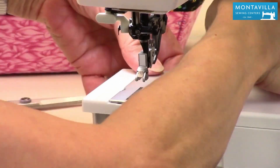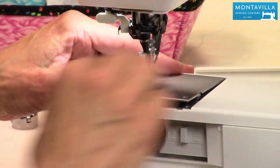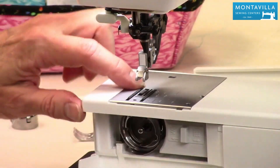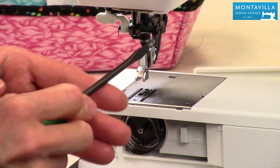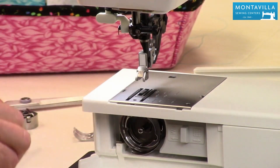I don't think I got it all the way on — I'm going to put that back on. I think you've got to start from the back. There we go — I heard that click into the back right there. So put it in the back first and then click it down. That'll make sure that the feed dogs come up above the needle plate. So if you feel like they're not coming all the way up, take it back off, make sure it's connected in back, and push it down.